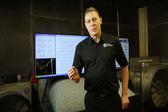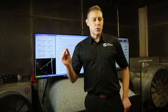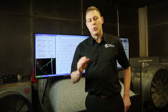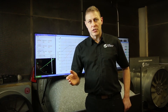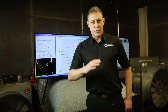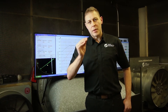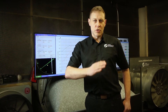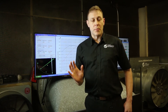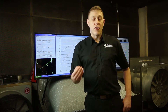For us at Torque Developments, we're all about vehicle performance, not just a maximum horsepower figure on a piece of paper. We spend a lot of time looking at the average horsepower that's generated by an engine across an RPM band swept by the rev counter of your vehicle when you change from one gear to the next. It's the average horsepower that's effective across one gear change to the next that you really feel in the seat pushing you in the back. Having a very high peak number is no guarantee of having a fast car in the real world.